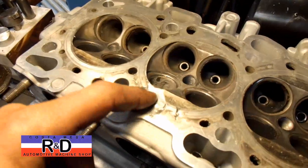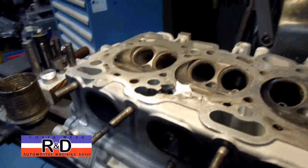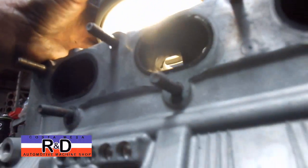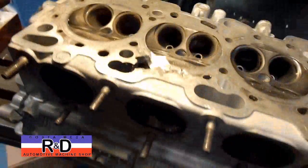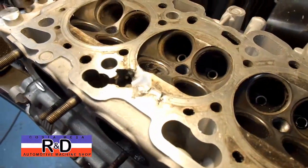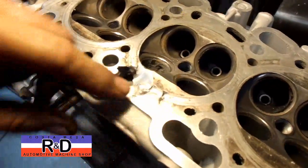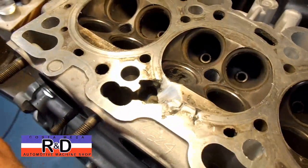It had some torching action going on here, and actually went down into the exhaust ports. I don't know if you can see that down there or not, but it's pretty bad stuff. This is caused by detonation and overpressure, overpressurizing the cylinder. There are a couple little spots here that actually dug out, but it went way deep here on the water port.